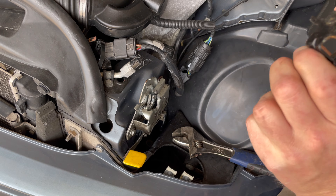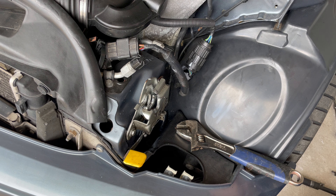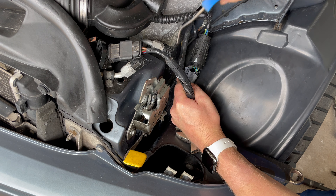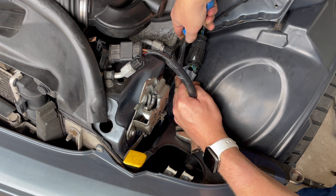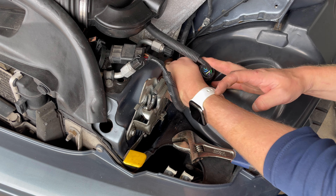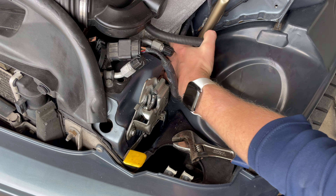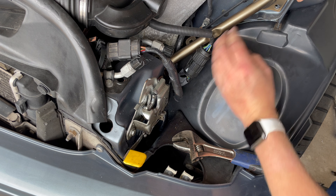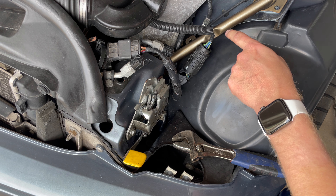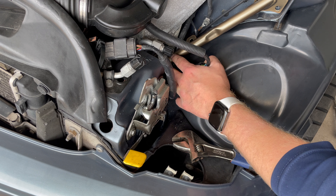The bracket is now out of the way — we need this to put onto the strut brace, which clips on there, but that's easy enough with a pair of pliers. Just below this wire — it's all very hard to see but as soon as you're down here it's obvious — there's a little plastic bung. Let's get that out. It's exactly the same plastic bungs as you removed at the top. The bigger end always goes at the top. We know that bolts into there, and as you put this against the chassis you'll be able to see. There's a bolt right against this, so you could take the wheel arch liner out to make it easier, but I'll do that one up by hand to start.